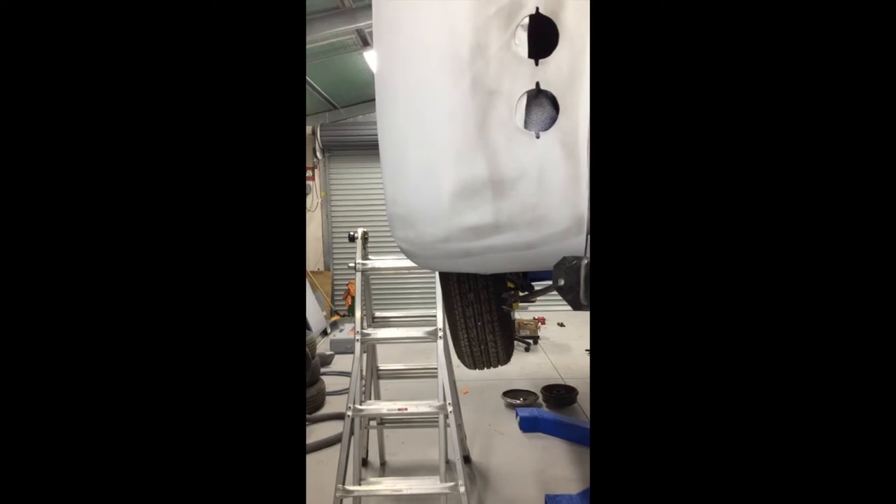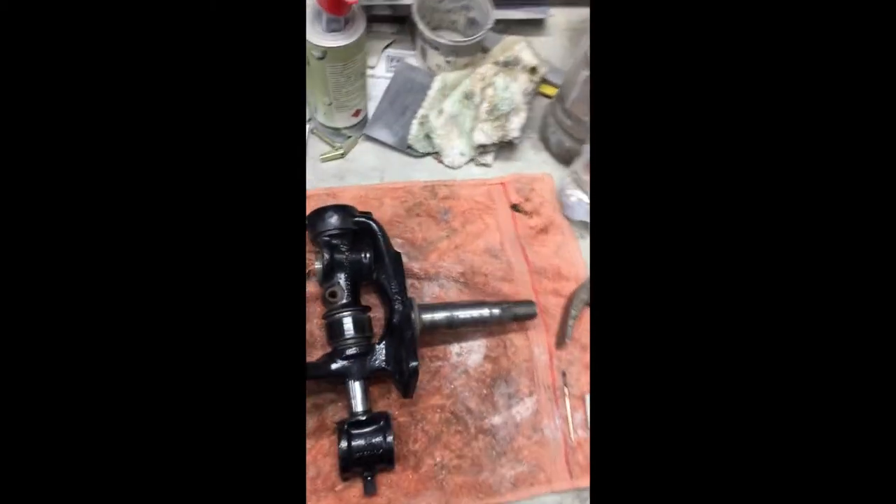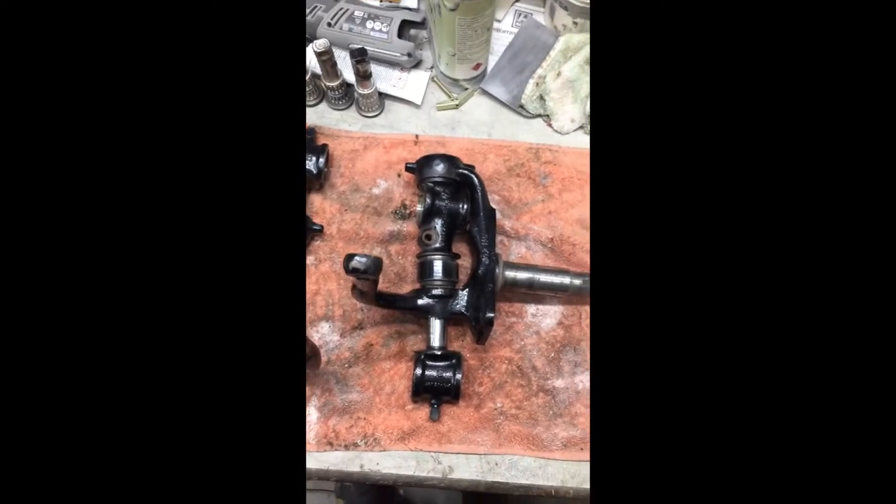The big issue with this bus here - you can see when you look at that - it's up in the air but you've got a shitload of positive camber, and I don't like that at all. Looks ugly, unsafe on cornering, you name it. So once I get this into neutral camber and slightly negative, that's where we run into the problem at the front of the bus where it's not low enough. Hence why we have to do this as well as the fine tuning with the adjusters.